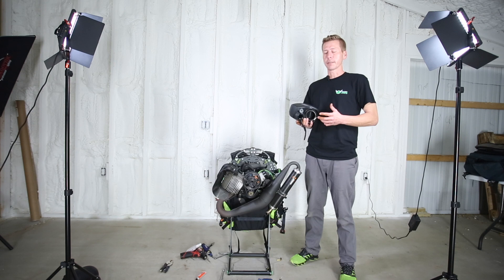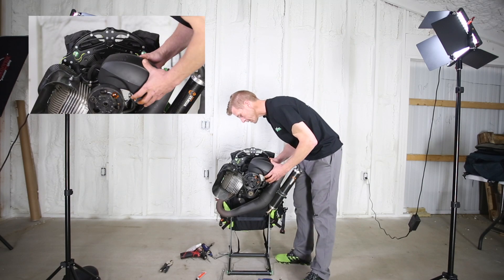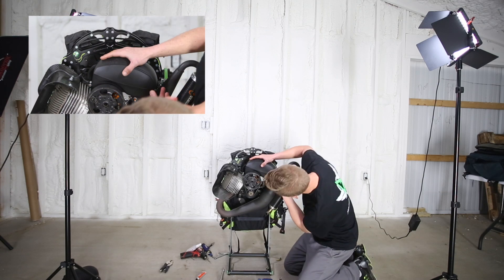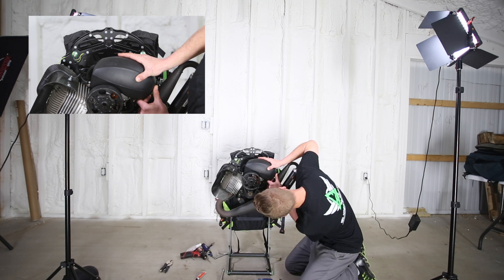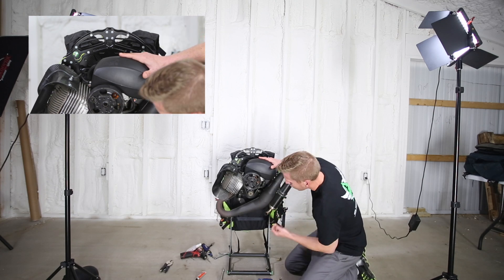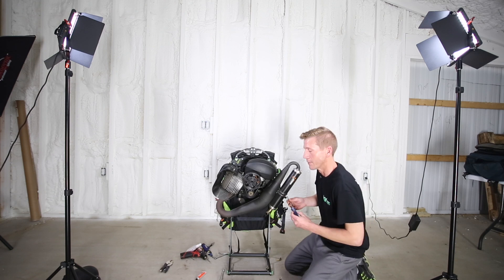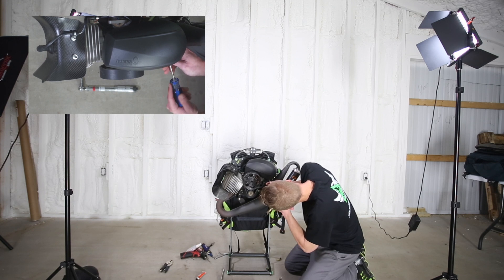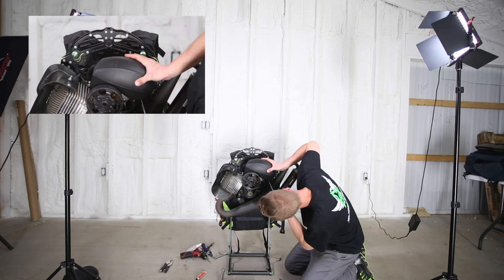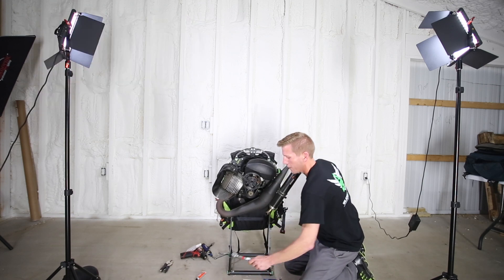We are now ready to install the airbox. Go ahead and take a moment to make sure the clamp is aligned where you can reach it, and slide the rubber manifold over the air intake and attach the snap lock. Get low because we really want to see that the rubber manifold is seated securely against the air intake, and you want the clamp to be resting but not overlapping the rubber manifold ledge that's next to the air intake. Pre-tension the clamp, apply a little force as you do that to make sure everything's lined up, and go ahead and finish it off with the torque wrench.